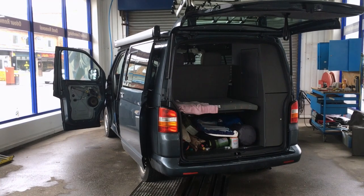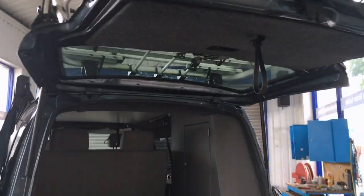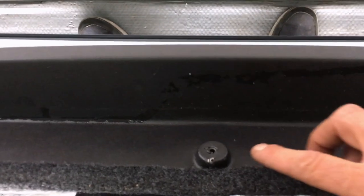Quick video for Michael - we've started taking a few bits off. I removed the tailgate cover which was on top causing the issue, re-shot it and tested it and it seems to have now stopped leaking. Looking at the fixture points which go through, this one here looks like it had trouble - it seems to have two fasteners in there and this bit up here isn't going through the middle hole, it's actually been put through the top. It looks like it hasn't been fitted correctly, but hopefully we can get it in place without having to shave those bits off.